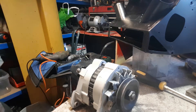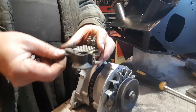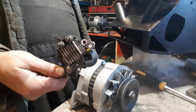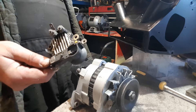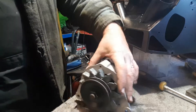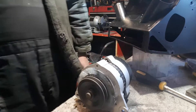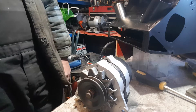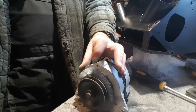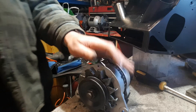On newer alternators, as I've seen, you can't really do an awful lot with it — you just buy that module as a module with brushes in it. I don't see any way of getting the brushes out of it; they're all moulded in and you just buy that unit. Whether that unit is cheaper than buying a whole alternator — it's debatable. You've got bearings in the alternator which have got a certain life to them. The ones in this one — whisper quiet. There's plenty of stuff on YouTube around alternators, but I just thought I'd show you one about classic Lucas alternators because it's about the only alternator that's not that widely represented. Anyway, that was it. Bye.